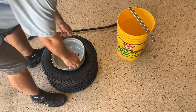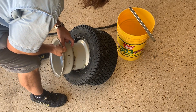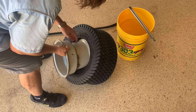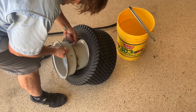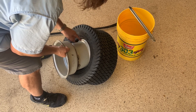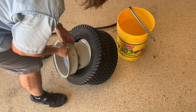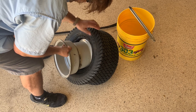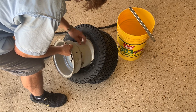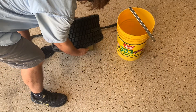Something to notice here: this rim has got a thick side and a small side. You want to put the small side in first because this extra space in the hole is what gives you the ability to easily pop that in. If you're trying to fight across the whole extra two inches it makes it a lot more difficult. So put this one in first because you only have the small lip to hop over, then you're into the well of the rim, and that's going to make your job a lot easier for getting it initially on the rim.